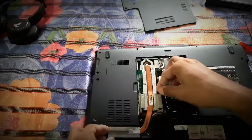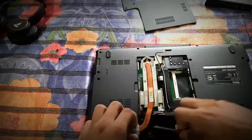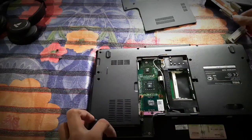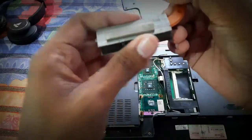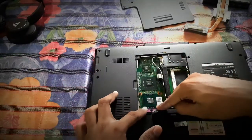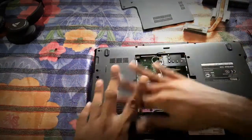You need to be very careful removing these things. The heat sink comes apart like this — just place it in a safe position. You can see some dust in here. I had already opened this thing the previous month and I got to see a lot of dust — crazy amount of dust. Now you can see the processor and the VRAM. You can see the thermal paste on top of it, so you need to make sure that thermal paste is intact.